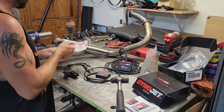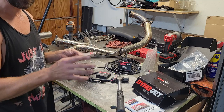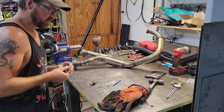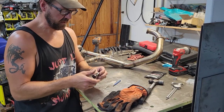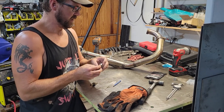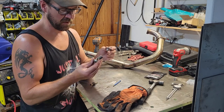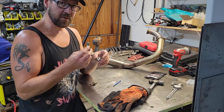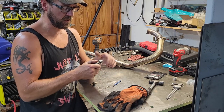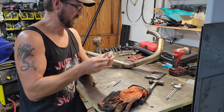I'm going to drill these out. I got them marked already and I'm going to get these welded on, and then we'll do a quick test fit and then we'll go back to making a skid plate. For installing these things, you definitely don't want to have your O2 sensor in the bung when you weld it in, unless you want to spend another 150 plus dollars on a new O2 sensor. What's good to do is find another bolt that fits in there, and after you drill your hole, that bolt will help align your bung when you go to weld it on.